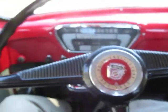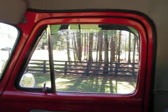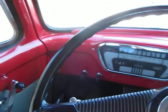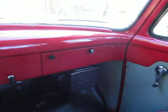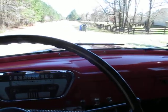Hey, it's Eric here at Peach Street Classic Cars, and I'm super excited about this vehicle. It is a 1953, 50th anniversary F100, and there's a lot of really special things about this truck. It's the first year of the F100, it's a 50th anniversary, and it's the last year they put a 239 flathead V8 in it. I pulled the VIN code — the R code is a 239, so we believe the engine is original.